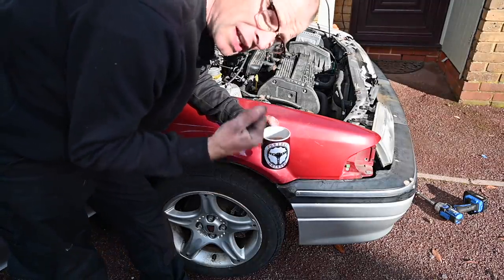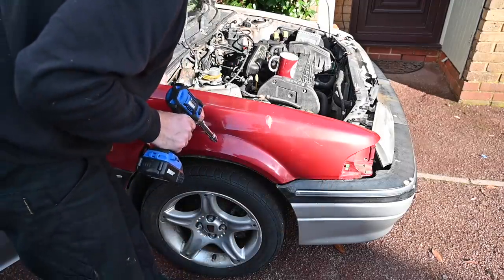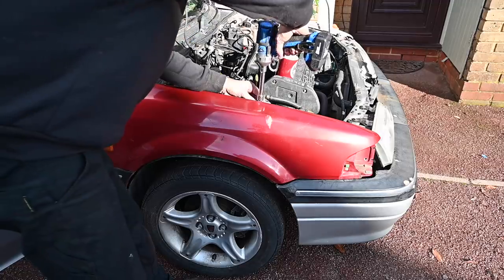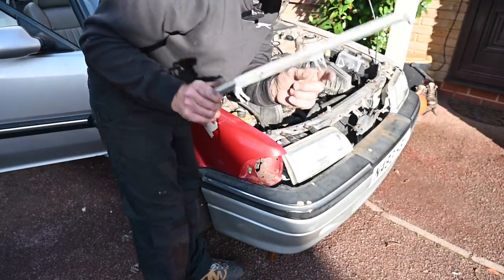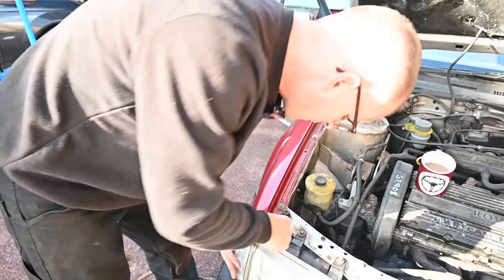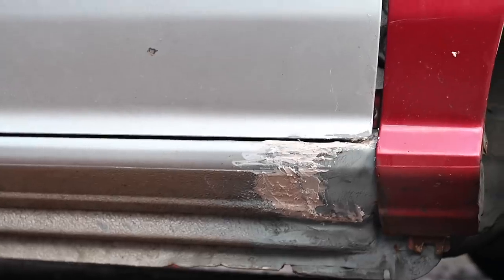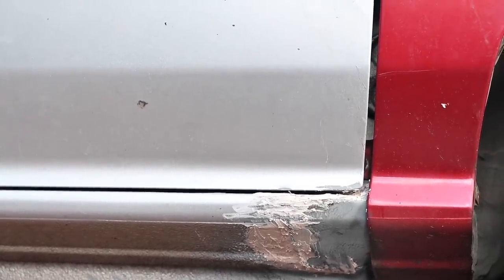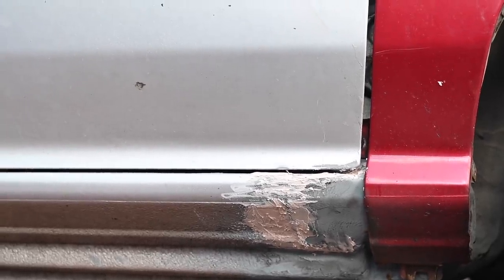I now just need to figure out where all these go, because it's been weeks since I took them off. That one needs a spanner. Now this finisher should clip under here, but I'm going to leave it off for the moment, because these are plastic clips and every time I use a plastic clip it gets weaker, and one's already broken off - and it's going to have to come off for the whole front end to be painted anyhow, so I'll leave this out to avoid damaging it. Just a little cross-point Phillips screwdriver to tighten that one in there and we're done at the front. I've just skimmed that weld I did on the hole in the sill on the front with a little bit of filler just to kind of disguise it. I can sand that back, make it look a bit prettier when it's dry, and it won't be so obvious I've had to do a massive great weld.